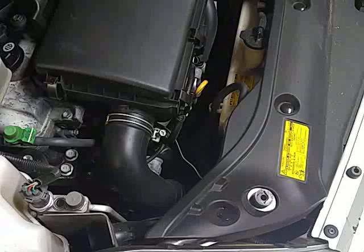Battery going dead, first one thing, another. But at 120,000 miles, it's the brakes, the drive belt, the oil, the engine oil filter, the cabin filter, the transmission. I changed it at 60,000, so I'm going to change it at 120, so it's 60,000 miles. I already changed the coolant. It's due to be changed at 100,000, and I changed the coolant at 100,000. I didn't make a video on that because I hadn't started making videos at that time. I think that's all at 120,000. I can't think of anything else. And of course, check everything.